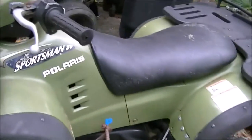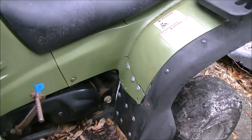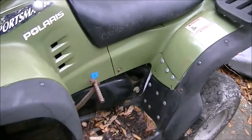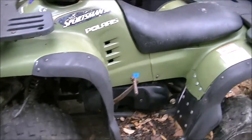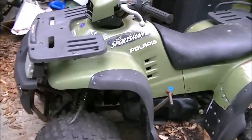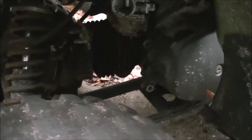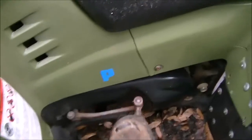I think I mentioned it — the guy got the little 49 or 50 cc — he gave this to me. It's a Polaris 90, but it needs a lot of work. I think they had spark issues because of that spark plug wire there. I'm guessing they had spark issues, couldn't get it to get spark, which is probably the CDI box. It's not locked up, so I figure if I can get it to spark...